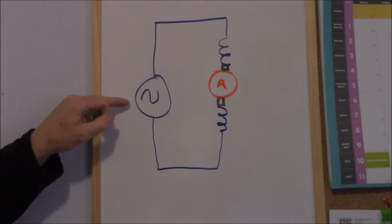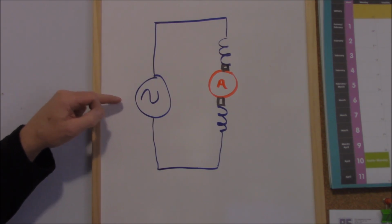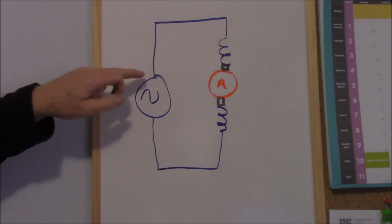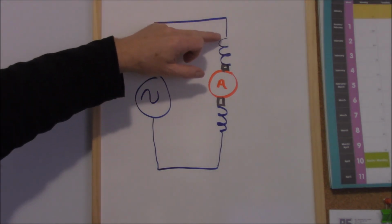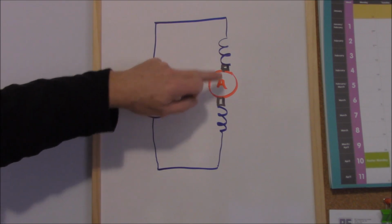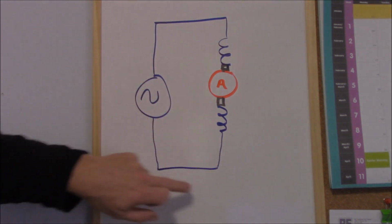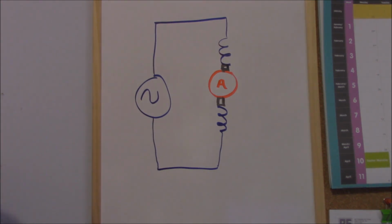As I said, a series wound motor only has one path to travel. Let me explain on the whiteboard. As in the case with any motor, we need a power supply. Our power supply in this case is supplied AC through our wall socket, isn't it? It goes in through one field coil or field winding through here, through a brush, through our armature via a commutator, out the other brush, through the other field coil, and then back to neutral in the power supply there.